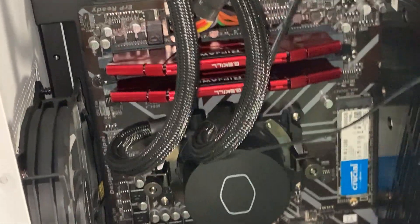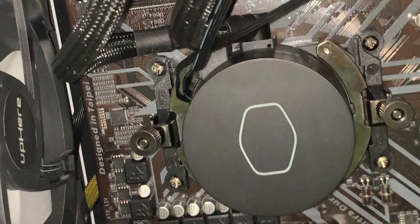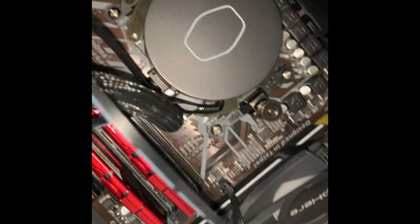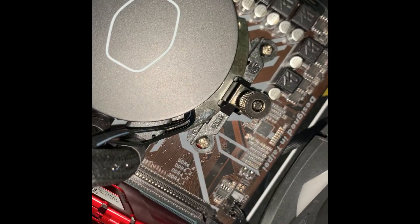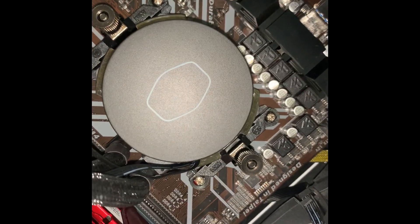I finally managed to put on the CPU block. It's kind of tricky — you have to line up the side nibs and hold it down the entire time since the pipes are quite rigid. Since we have three components — two fans and the pump — you need to grab the included cable splitter. This is the RGB splitter: it takes your one RGB connection and splits it into three. Since my motherboard is a B450M, it doesn't have a CPU opt header, so I took the three-pin connection from the pump and plugged it into the CPU fan header. Since the pump runs at 100% all the time anyway, that's perfectly fine — the fourth pin is for PWM.